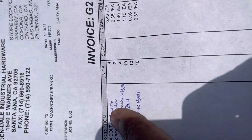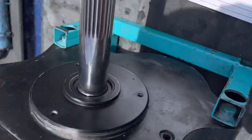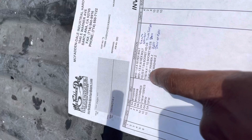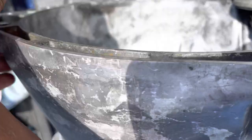This is the four bolts — M10 1.5 — these are the four bolts from the bell housing to the block. These are the two starter bolts from the starter to the bell housing. Then the trans-to-bell-housing bolts. The 7/16s are the bell housing bolts with washers — you need 3/8 washers for the bolts in the bell housing and half-inch washers for the trans to the bell. I got two on each just in case bolts bottom out, because some of them definitely need washers.